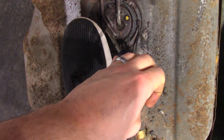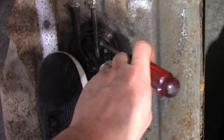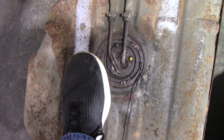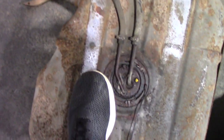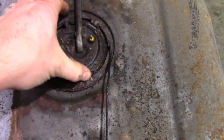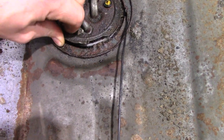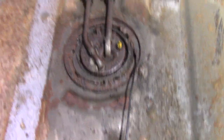Okay guys, so to get this sending unit off, there's a tab on here and you just take a screwdriver and hit it with a hammer right here - it just knocks right off. Just twist on around through there and pull it out. Then start filling it up full of water, wash it out, and keep it full of water. Then we'll cut that filler neck off and we'll be in good shape. We just twisted this ring all the way around and now the ring comes off. Then we'll take it outside, drain it out, send water through it, and start working on it.